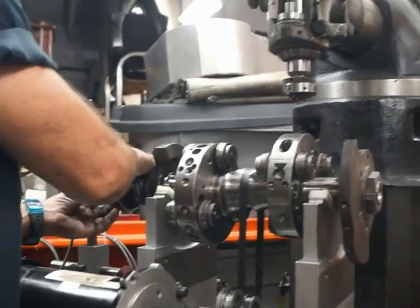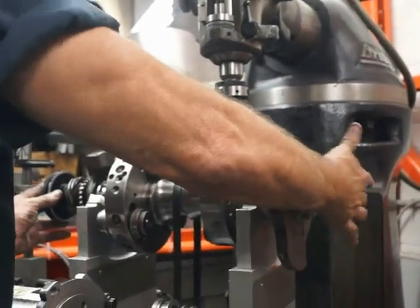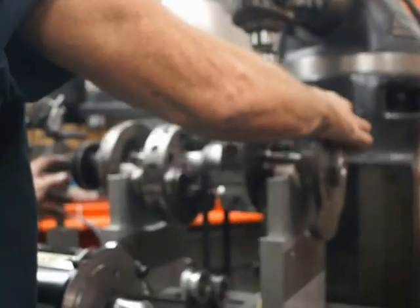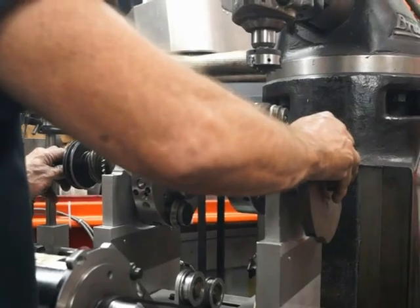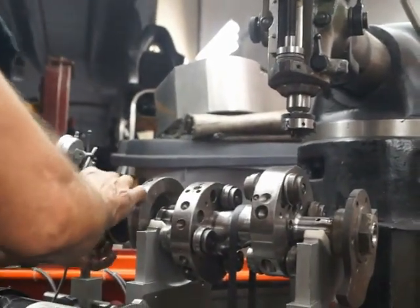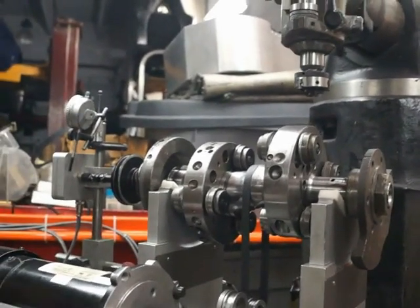Aren't you going to change that rear counterweight? Save it for the heavy. First, I'm going to check that the front is correct. Then I'm going to try some other rear counterweights that have already been reduced on the keel of the counterweight. See if I can get it in balance. Realistically speaking, 33 grams is quite a bit to take out.